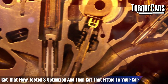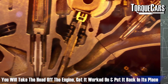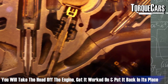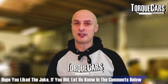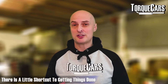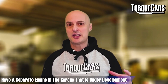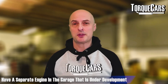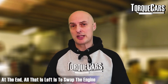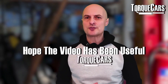Get the new head flow-tested and optimized, then fit it to your car. The benefit is that you're not off the road for a long period — normally you'd take your head off, get it worked on, and be without the car until it's ready. A useful shortcut is to source and prepare a second head in advance. Some people with project cars keep a daily driver while developing a fully built engine in the garage with all the performance parts, spending as long as they need perfecting it before doing a straight engine swap, so the car is off the road for as short a time as possible.